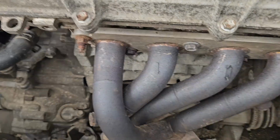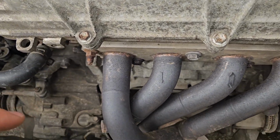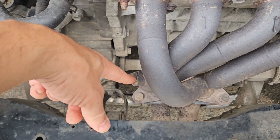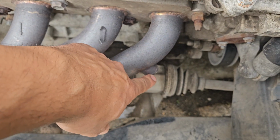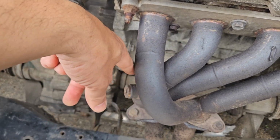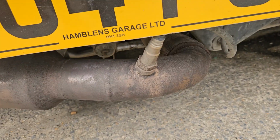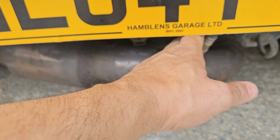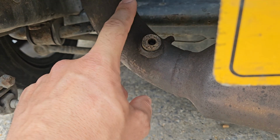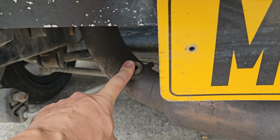The issues you have with the engine bay are, like I say, the pre-cats. You also have on the top of the two pre-cats one lambda sensor each, so two lambda sensors. Now this is bank 1 sensor 1 this side, bank 2 sensor 1 this side. You'd also then follow it down around. This is different because I've got an aftermarket ECU, so ignore that. You then have the cat, you then have another one here. This is bank 1 sensor 2. So if you do an OBD read, that's the difference.